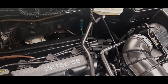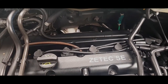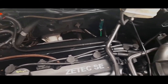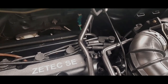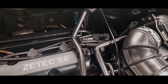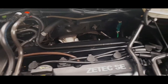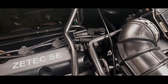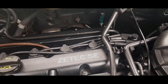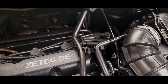One last major thing, and it is a service item: change your spark plugs. If you don't, there is a huge risk that — whether you have an original coil pack or a newer style one — they can spark and surge because of worn plugs. Usually the plugs crack, and when they go they can surge and spike the ECU. There have been many cases of coil packs spiking the ECU, and then you need the ECU repaired.